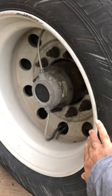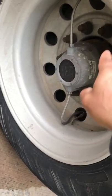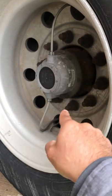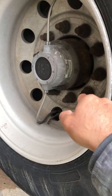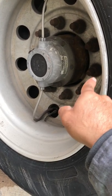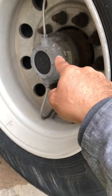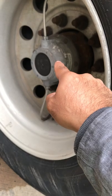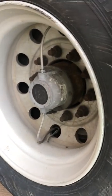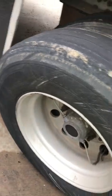You got the rim, properly mounted and secure, no illegal welds, not cracked or broken. Lug nuts, properly mounted and secure, not rusted, none of them are missing, and there are no signs of residue or dust or anything that shows they're loose. Axle hub, properly mounted and secure, not cracked or broken, not leaking and filled to manufacturer specifications. The tires are checked with an air gauge to make sure they're fully at manufacturer specifications.